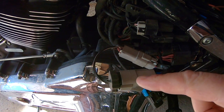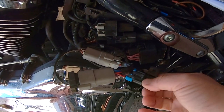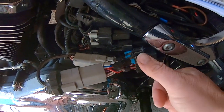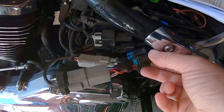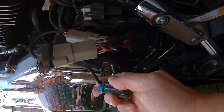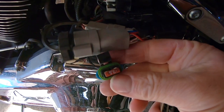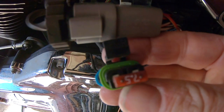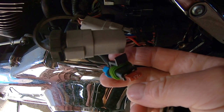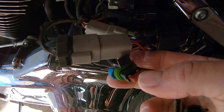The other thing you need to look at is this fuse holder here, which usually sits on top of your main fuse right there. What you need to do is take the cover off here. You'll see right there there is a 7.5 amp fuse. I'm going to show you exactly what you do with that — basically, you're going to take this fuse out.